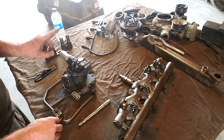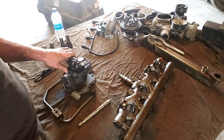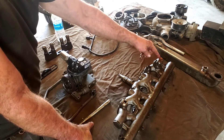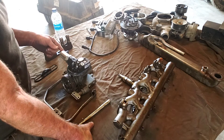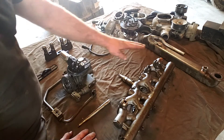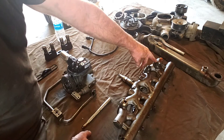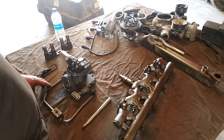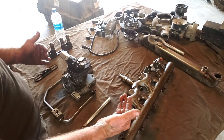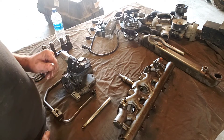The IPR regulates the high-pressure oil pump. You've got to have 500 PSI just to start, and it can get as high as 2,000. The IPR and ICP — injection pressure regulator and injection control pressure — communicate back and forth, so you could have a problem there too. As far as leaks go, it's right here; I can do another video on how to test it — we've got a testing tool and we'll use this port. This is on the 05 and later models. Now let's get into what failed on this engine. We'll start with the low-pressure oil system.